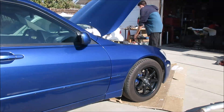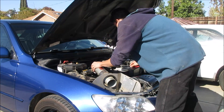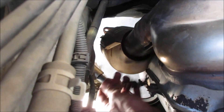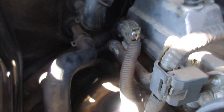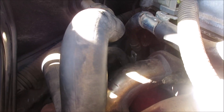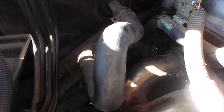That third sensor is not easy to take out, so just be very gentle not to break it. When you do release it, it's held by a clip at the bottom which is almost like a zip tie. You're going to have to break that off too. When you put it back on the new headers, just use a regular zip tie in that same bracket at the bottom — you'll know what I'm talking about once you take it off.